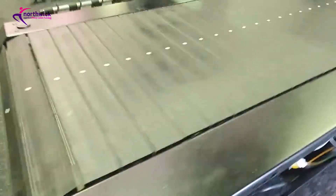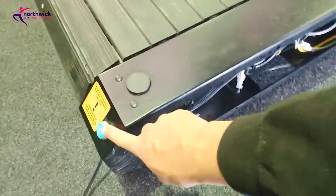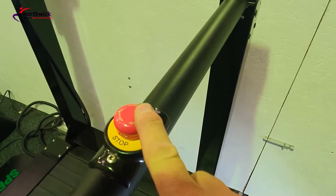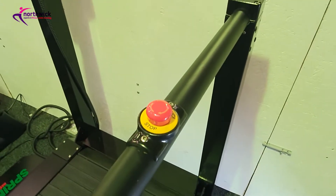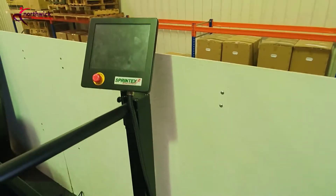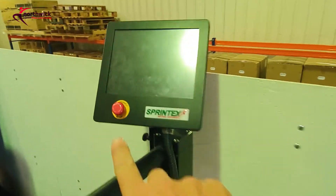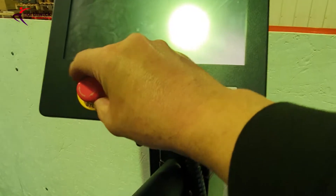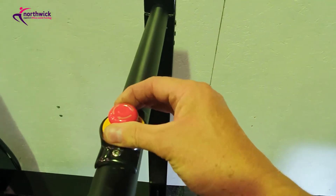In terms of the service itself - cleaning inside - first of all power off, of course. That's the on/off button there. You also need to make sure the emergency stop buttons are working and when you press them they click in. If you're trying to restart the machine, always make sure these are twisted and pulled out, otherwise the machine will not start.